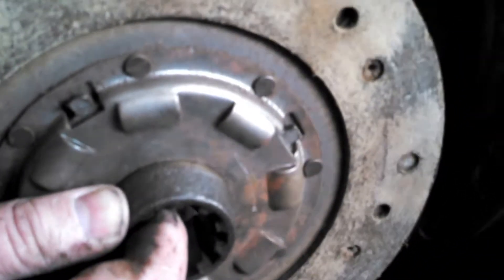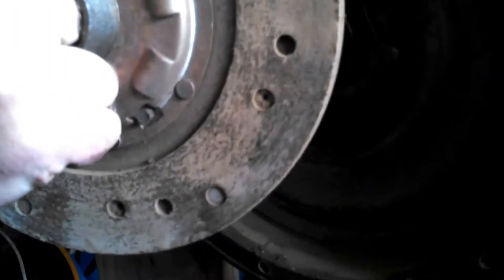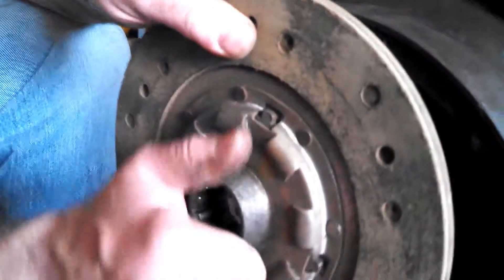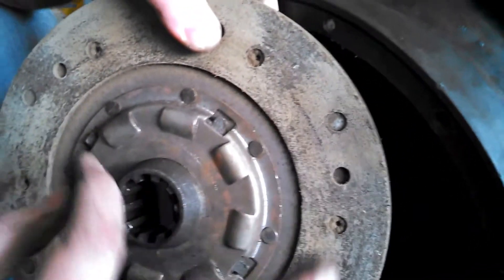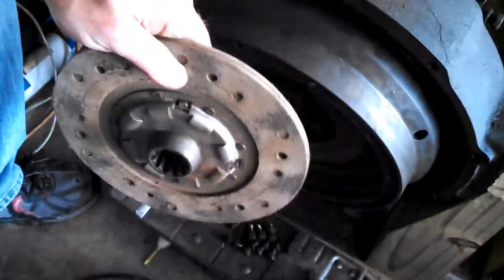There's a metal plate in the middle, and this material here is like a brake pad - a friction material - and here are springs. I can't turn it because it's really hard to turn. But what happens is when the engine is spinning and you first throw it in gear and let off the clutch, this thing is stationary or not spinning at the same speed. These are little but really strong springs in there that let it flex a little bit to absorb the bump.